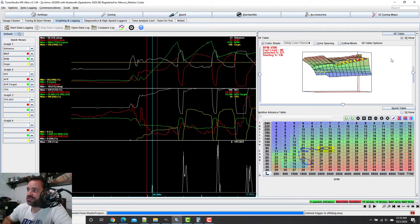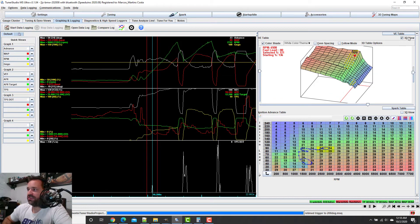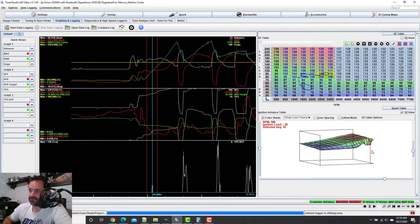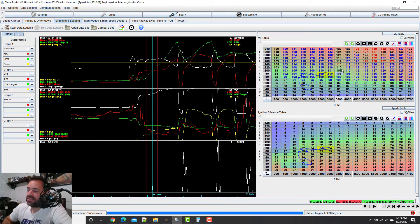If you see the 3D graph, there's no reason for it to look like this — it's like a desert picture. It should be more like a ramp with a little bump, not like that. What we can see: here for example is 127, then it goes up; here we have two same numbers — I don't quite like that. Same numbers again, 38, and then it goes to 38, 34, 32, 31, 26 — which is fine — but then it goes back to 30 and 27. This number should never be greater than this number here.